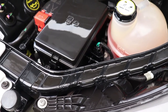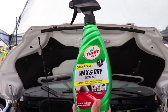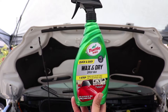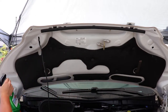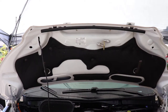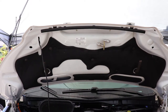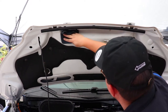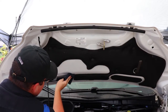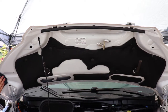Once the spent product dries enough, you can wipe away any high spots that may have formed, spreading the product more evenly and leaving a consistent layer of protection. Because it was hot outside, I skipped the blower for drying and let the weather do the work. In that drying time, I moved forward by applying a sprayable wet wax on the painted surfaces. My advice for detailers: use a simple wax — there's no need to add a glaze, sealant, or ceramic coating unless you're working on a show car.